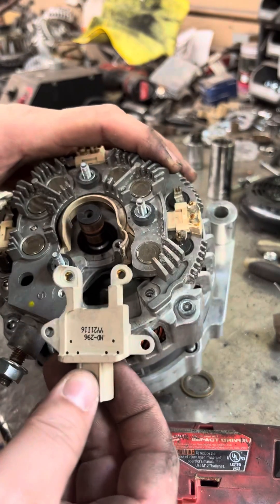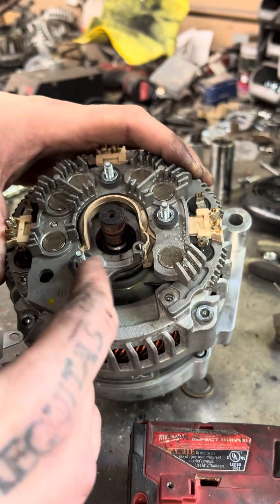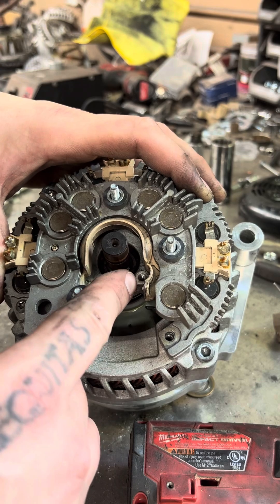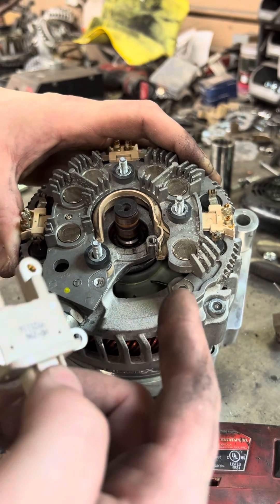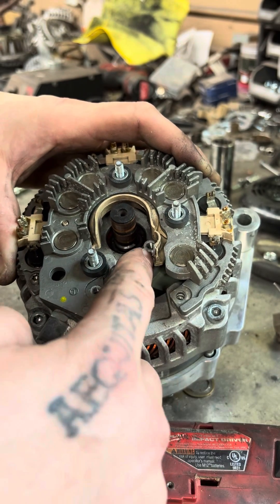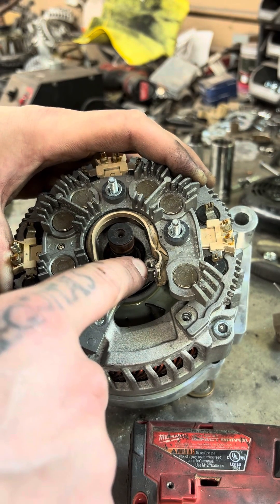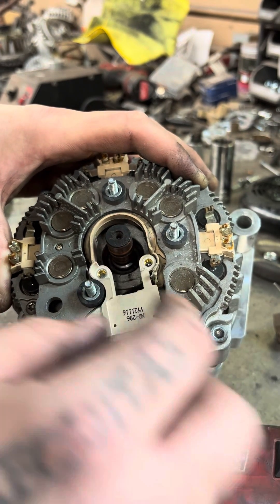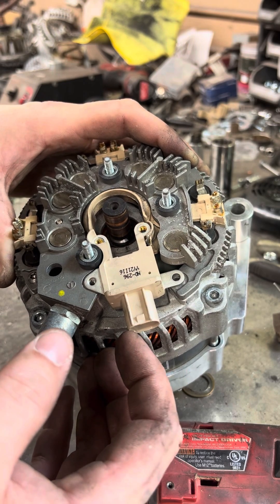The new regulator outlet will have two legs on it. If your alternator is already internally regulated, 90% of the time you're gonna have an aluminum mounting boss here for a ground — that internally grounds whatever terminal socket you're using. Normally, if we build the alternator from scratch externally regulated, we'll drill or cut that boss off in a mill. You can drill it out and then you'll end up having to use both pins on your external regulator.